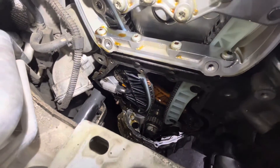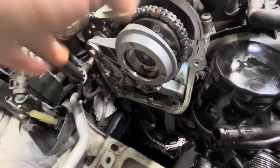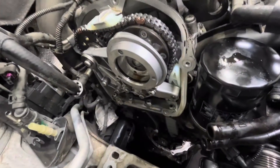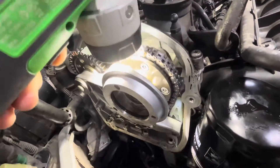the tensioner comes out further and then the other side of the chain is then longer. So this intake cam — both cams, but this intake cam — with the crank in the same position would rotate counterclockwise, and that position would be picked up at the cam position sensor right here. So it knows the position of the crankshaft, it knows the position of the camshaft; the chain stretches and this starts to clock counterclockwise.